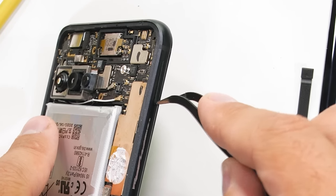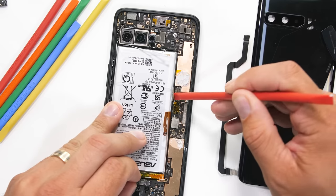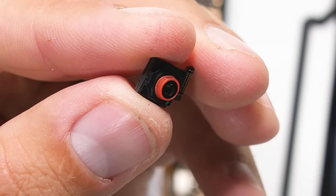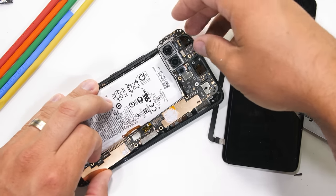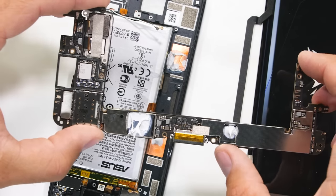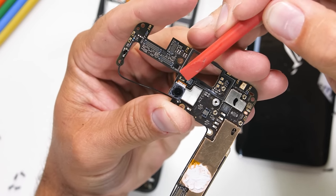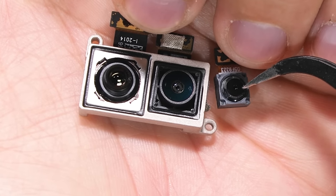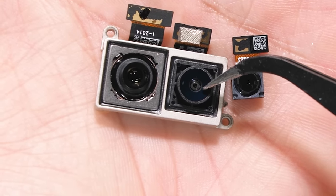I can take out the SIM card tray, then unlatch the last ribbon cable plugged in between the copper pads and pop off the front-facing 24-megapixel camera, which films in 1080p. With a little persuasion, the whole motherboard can come out of the phone, exposing even more thermal paste and copper below it. Let's remove the three rear cameras: the 64-megapixel main camera capable of filming in 8K, the 13-megapixel ultra-wide camera in the center, and the 5-megapixel macro camera on the edge. None of which have optical image stabilization.